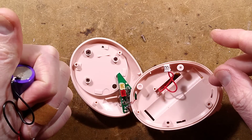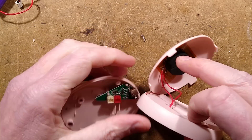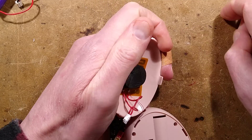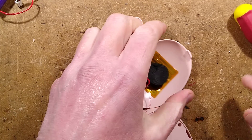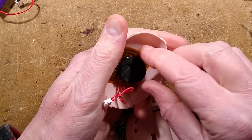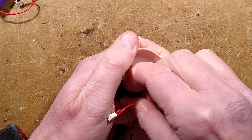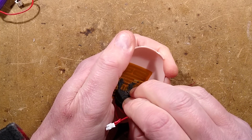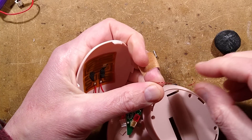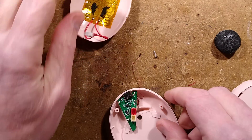It feels warmish — I think it was giving off more heat at the heating element. Let's take this big sponge off. I may have to apply isopropanol to see if I can liberate the adhesive and get the thermistor to separate. It is going to be a little bead thermistor. I bet that's a 10k thermistor — they're very common. Let's get the meter in.